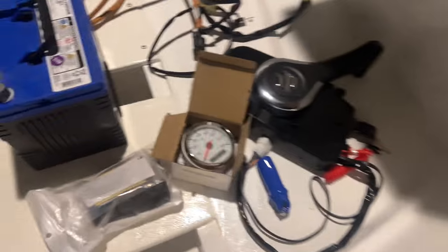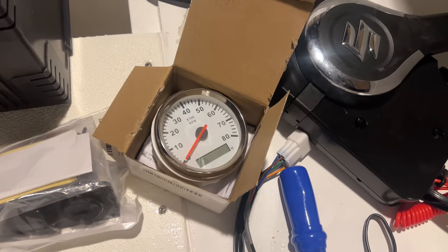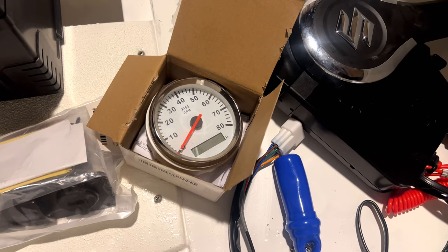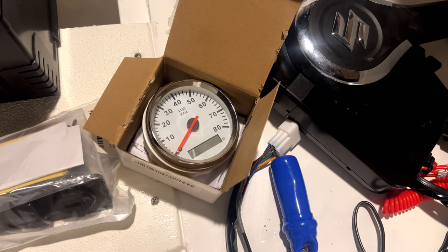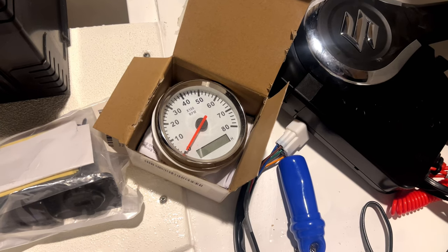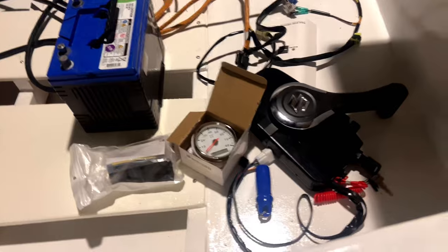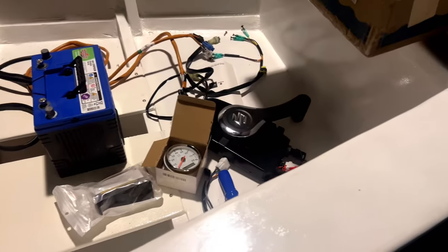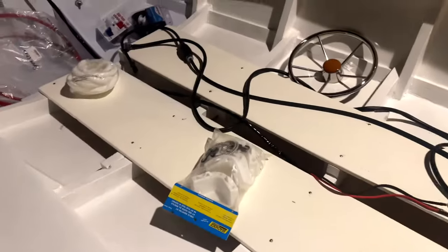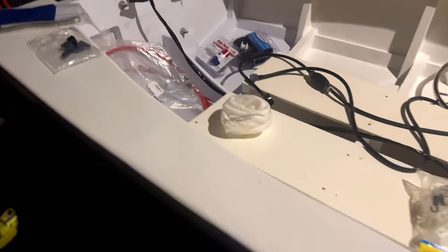Then I've got a tachometer for your outboard motor. It's not anything expensive, but it's really the best tool to make sure that motor is running right with this boat and the right prop and all that sort of thing. You're looking for a target range of RPMs. If you're comfortably in there, that means you're getting the most speed out of your boat and engine combination, if that makes any sense. And we'll talk more about that once we get this sucker on the water.